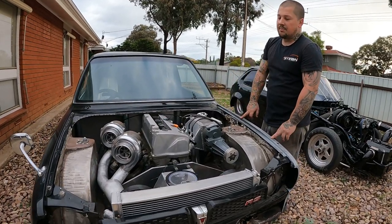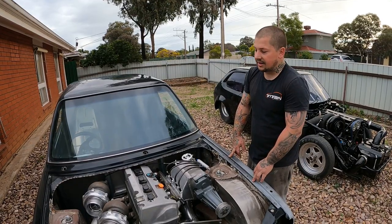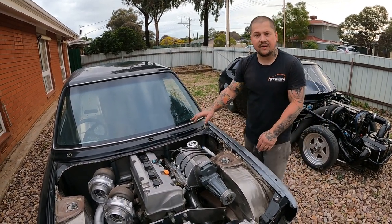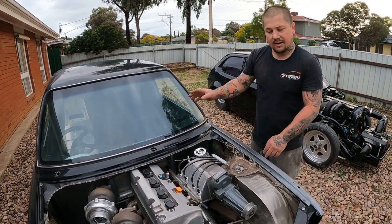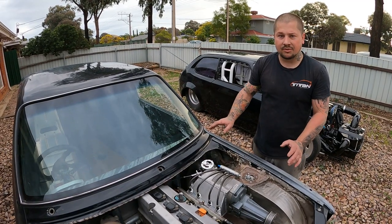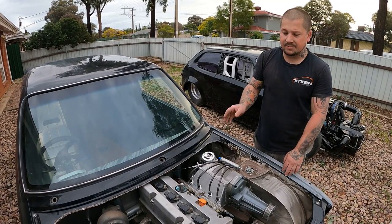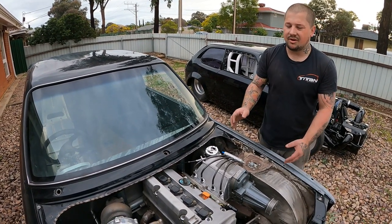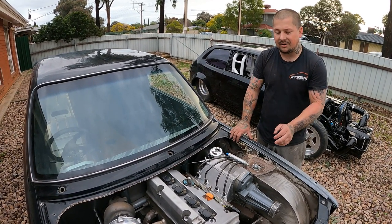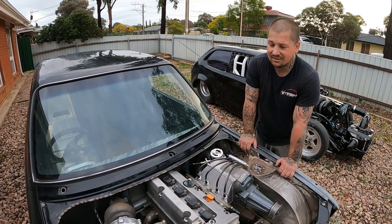For strength-wise, get a set of rods and pistons. Horsepower-wise, we're not going after the world record here at all guys. I'm not going for 1,000 horsepower. Going for around about 900 horsepower — that's where they're pretty much reliable. You don't need to go anything extensive there, you don't snap anything. So I'll put a set of rods and pistons in this thing and it should do it.